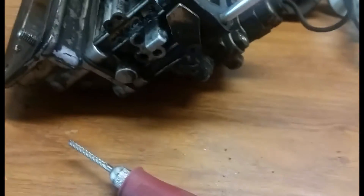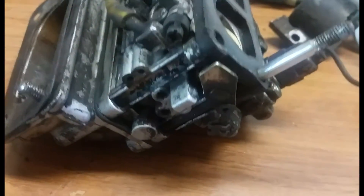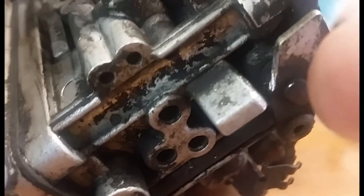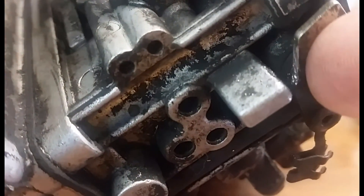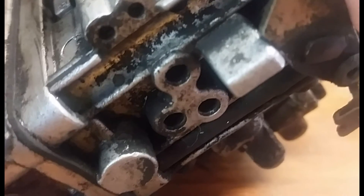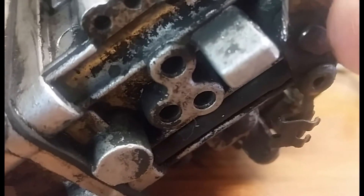I've got a flex cable tool on my Dremel. I'll show you where I want to start taking material off — you can kind of see where I've started. I'm using a carbide cutter, but you could use a grinder or just about anything. You just need to remove material from your throttle shaft to allow it to move farther until it stops.